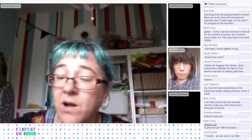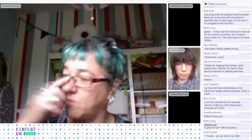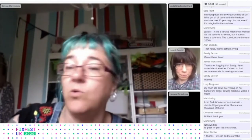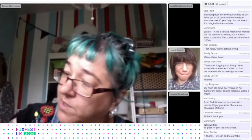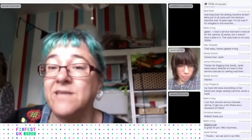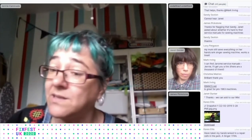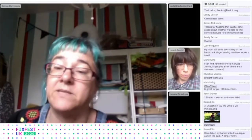So if you can take it apart, it just depends on how much you enjoy this kind of stuff, because I love it. So I just kind of go, well, that bit works and that bit doesn't, so the bit in the middle has to be the problem. So I just kind of wriggle and poke, and as long as you don't go in with a hammer or with a massive screwdriver, if you just wriggle and gently poke and just follow the line of, you know, this moves and then this goes into this bit here and then that's supposed to press that lever down, you can often figure out where the reverse lever is no longer connecting. It might be that a spring has become detached, but it could also be that when they serviced your machine, they knocked something and it just needs to be knocked back into place.